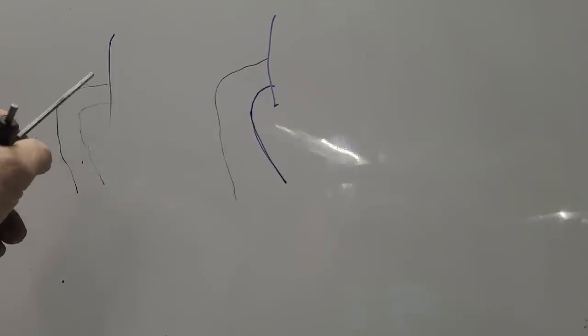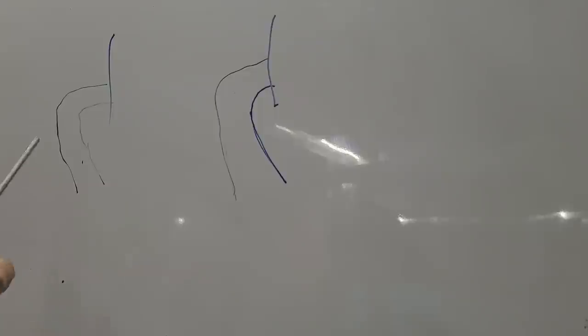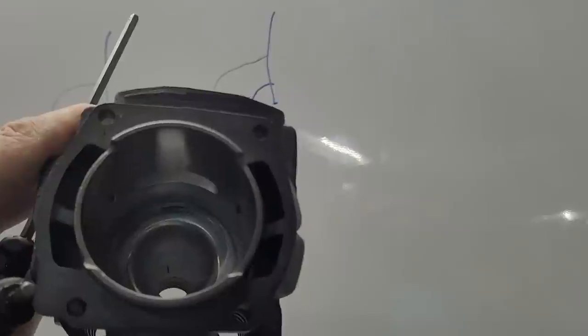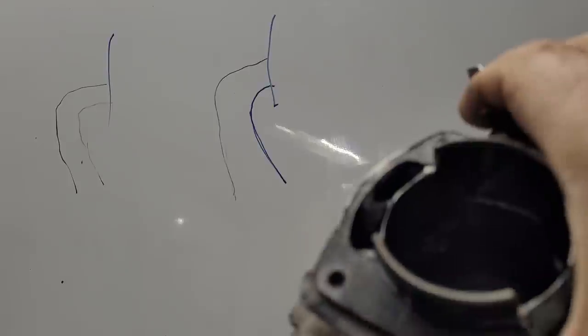Right now I'm talking about quad loop transfers — meaning the transfers are on the outside of the cylinder and you have four ports. This is a poor drawing, but let's say this is a factory stock 372. The cross-sectional view shows that the air-fuel comes out of the crankcase and enters — and these are fairly choked up quite honestly compared to the finished product.